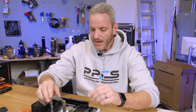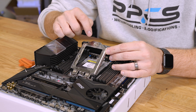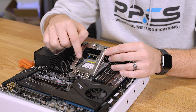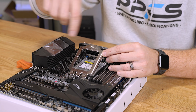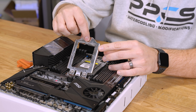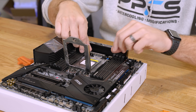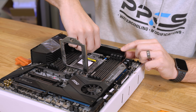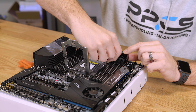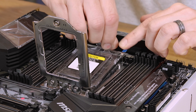Getting the torque down and the mount proper is the first battle to win with Threadripper. When you release the top screw, it's actually labeled right on the motherboard which order to close and which order to open — one, two, three to close, or three, two, one to open. Out of the box it just has one screw holding it down. It's spring-loaded, so that'll pop up, and then you have these blue tabs you can pull up for the retention bracket.